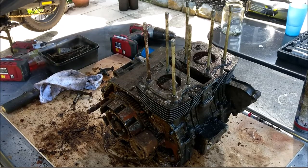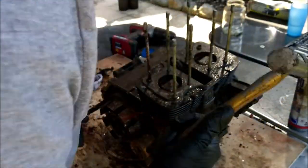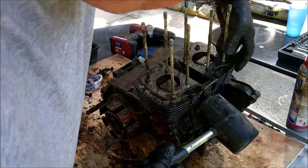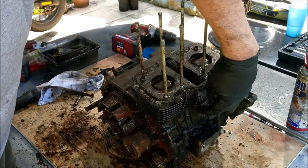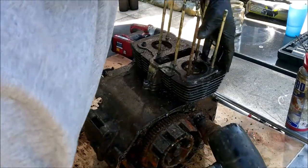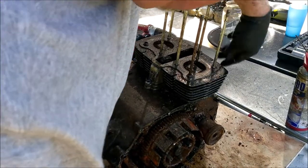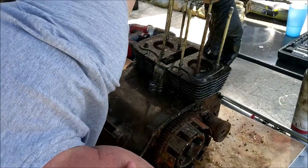Back to the shed. Okay, operation let's knock the block off has begun. I've been around the join there with a bit of lube. I started off using me toffee equaliser, but I've gone on to me heavy duty one, and I've literally been tapping and trying to pull, and I've finally broken that seal on the gasket, so things are looking up. You don't want to hit this with anything metallic because they will just splinter and shatter, and that'll be the end of that.